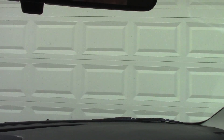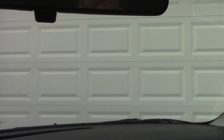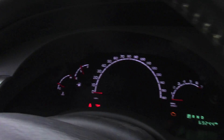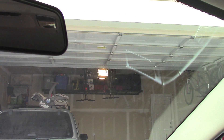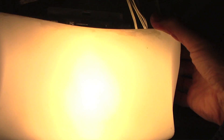Now I'm going to push the button and we'll see if it opens — no, not working. It says it's trained but it's not working. So what we're going to do is: the car knows the signal but for some reason it's not communicating it to the garage door. It is sending out a signal, so we're going to train the garage door opener to understand the signal.